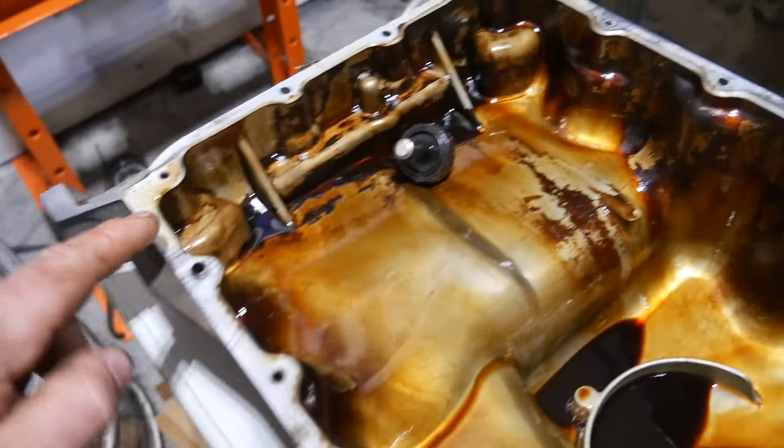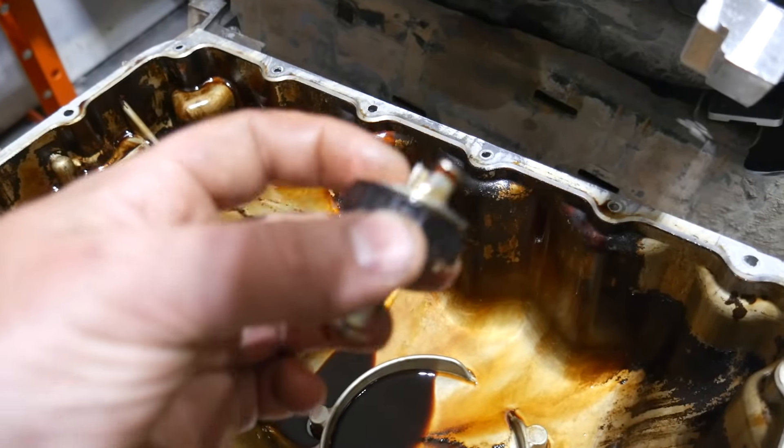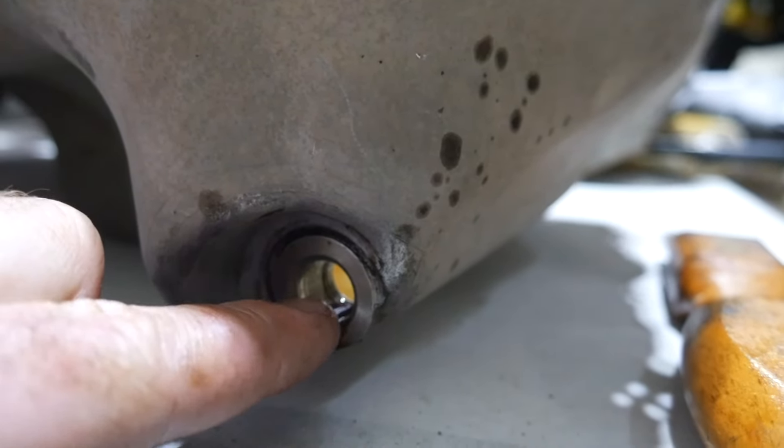So we've got our old oil pan. You can see that — this is that last resort plug. It's just kind of a rubber sandwich that gets created inside the oil pan. It's going to be really hard to see how bad this is stripped out, but this was helicoiled once and it just kept failing — aluminum pan.